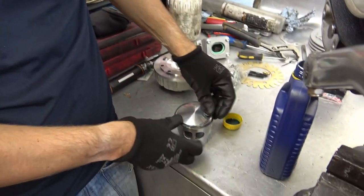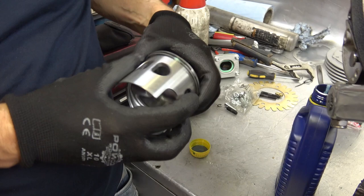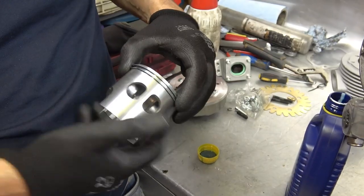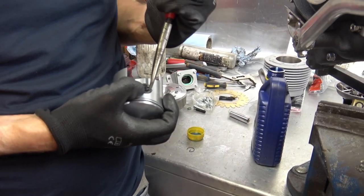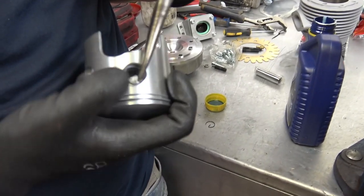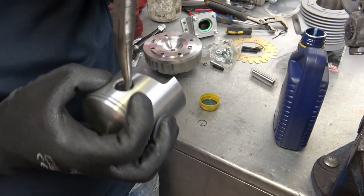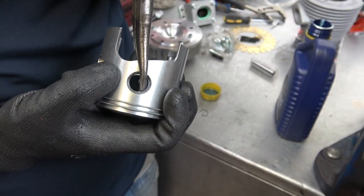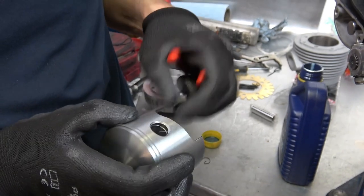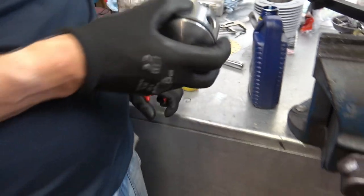They're not too stiff, these. Just bring the ring around to lubricate it — the rings are less likely to get trapped that way. We'll put one piston circlip in. Good practice is normally to leave the gap at the top or the bottom, as it's less likely to get squashed. That's not in properly yet — that's it, it's sat now. Give it a twist and make sure it's happy. Right, that's in.